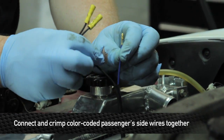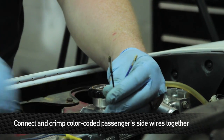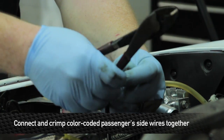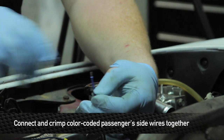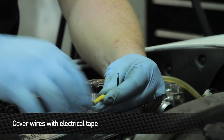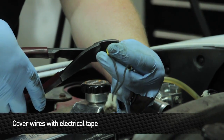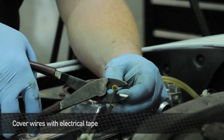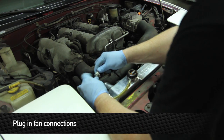On the right side of the car, the connector is a white connector for the fans. There's one black wire and one blue wire, but the only difference on this side is the blue is a black with a blue tracer. The black with a blue tracer goes to the solid blue on the Mishimoto fan, and the black from the Mishimoto fan connects directly to the black from the engine harness. After everything is butt connected, wrap it in electrical tape, plug it in, and tuck it out of the way of any moving parts.